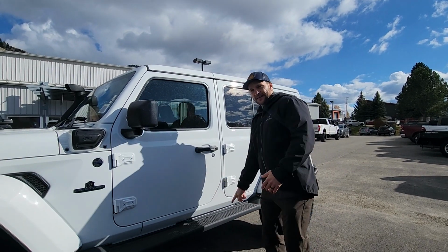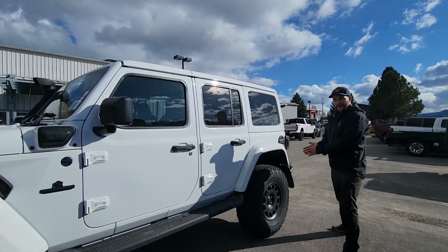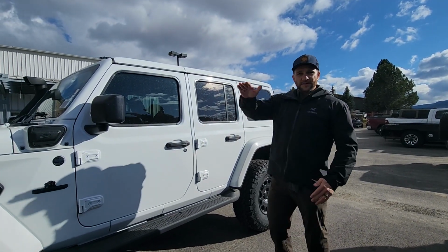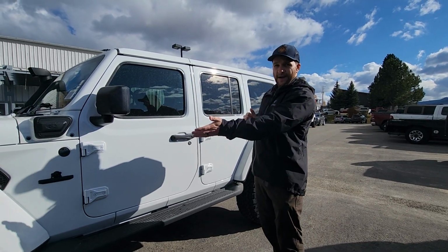That rear axle is like right here. Four doors here, Gladiators like clear back here. The springs have to know how far apart they are from each other. Otherwise, when you go over a set of bumps, the back end's just going to do this for a while till it catches up to the spring rate of the front.